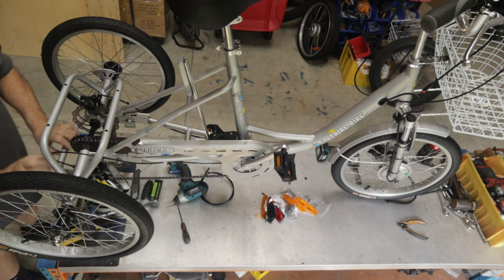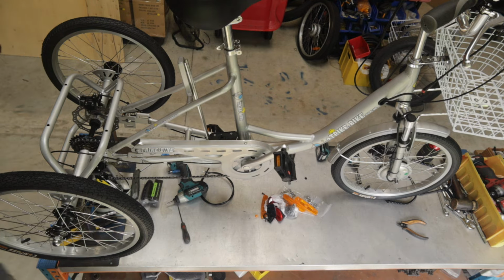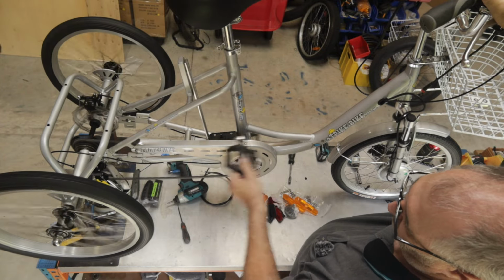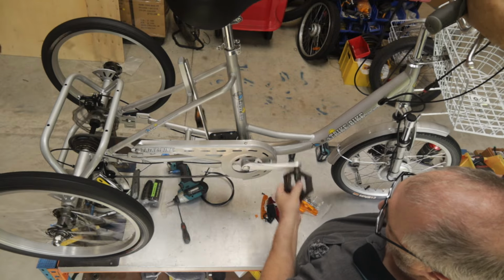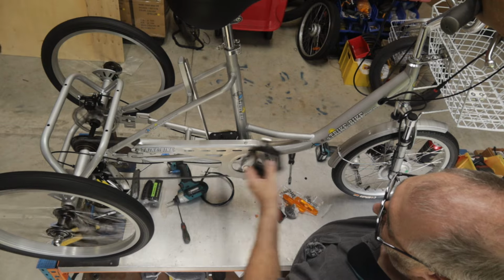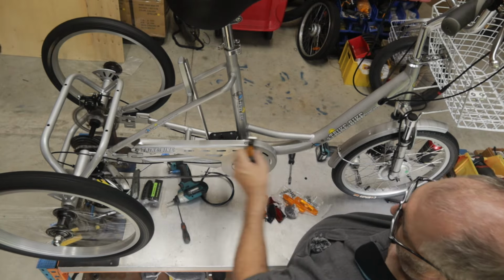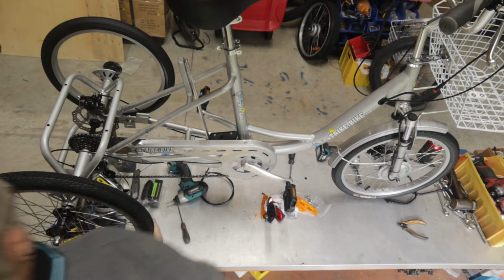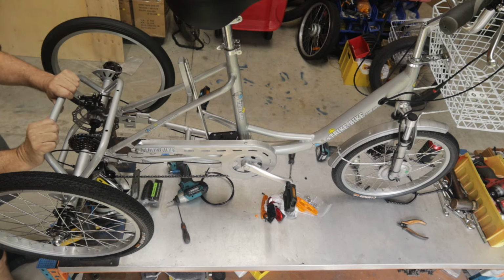You could probably come in a little bit, so I'm just going to wind this adjuster half a turn. You don't need much. A lot of people wind it a lot and they get into trouble. So there's no chatter at all there. Now it's perfect. Up 1, up to the top gear. You go down a gear, down another gear. Look, all that now is perfect. Go back up into top gear. So our gearing is now finished. Everything's right to go. So our brakes and everything, we can go ahead and fit the basket.